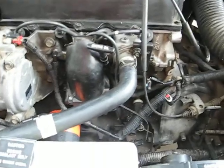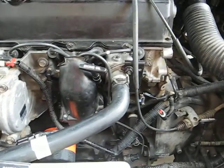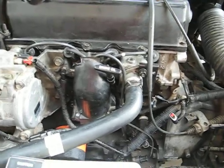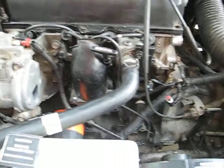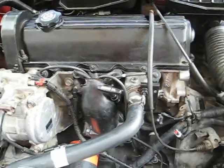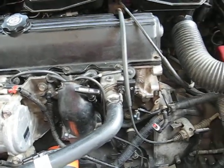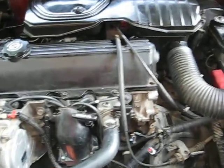It's got new spark plugs in it. We changed the oil out, fresh gasoline, fuel filter is in there. Now there are some fuel leaks — some of the lines at the fuel filter are kind of old. I'm going to show pictures. And the filler neck gasket is bad — that's at the gas tank.